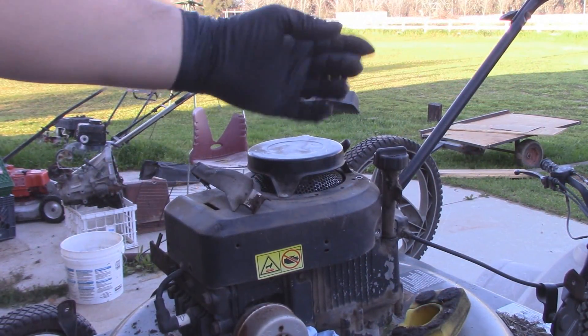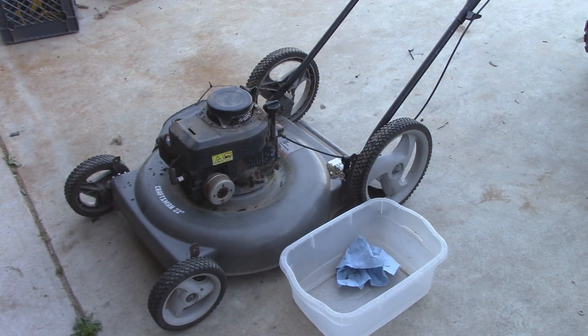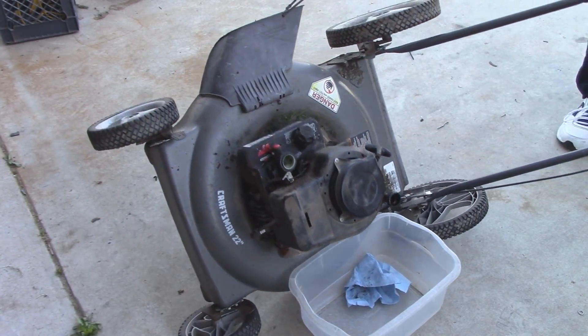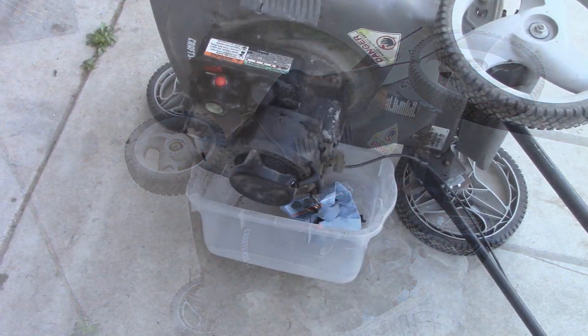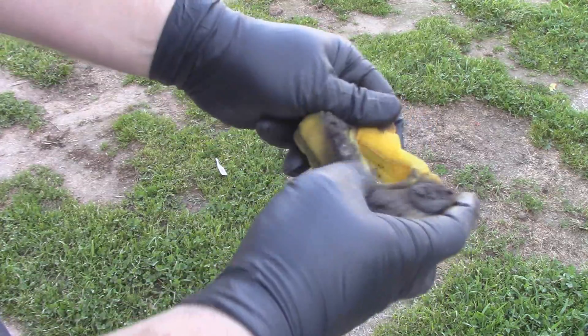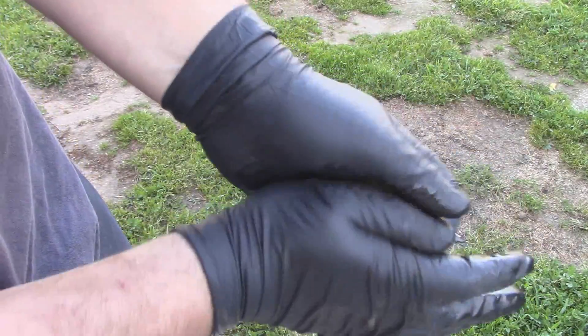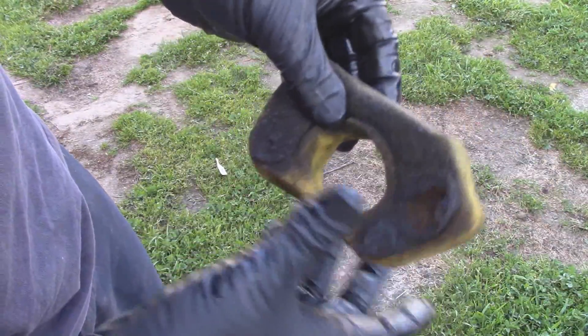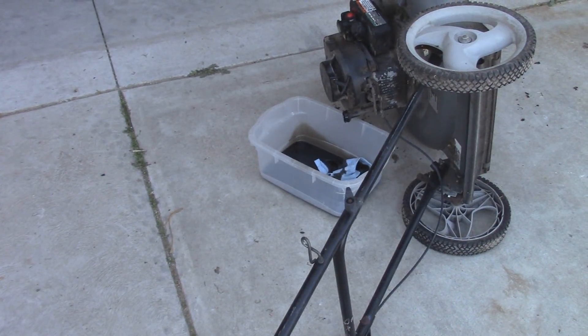The new handle has been installed. Now we just throw the bolts back in, thread the tank back on — all this goes back on the same way it came off. Now we're gearing up to change the oil — just let it drain. Cleaning the air filter is pretty straightforward: get off most of the debris by hand, then let it work as a sponge soaking up oil — that's how these foam filters clean the air. That's all nice and oily, so let's reinstall it. We're just getting drops now, so that's good enough.